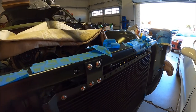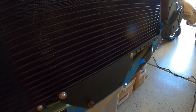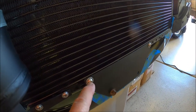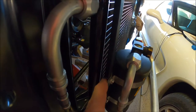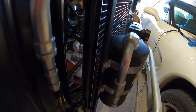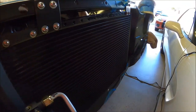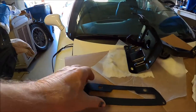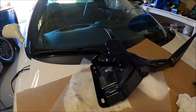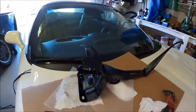So that's the modifications I made getting this thing mounted. I am going to go ahead and use their bottom mount, which works out fine. But I swapped out their number 10 stuff for the quarter 20. They also gave me some sheet metal screws, and I'm going to replace those with number 10s — I bought some number 10 button heads. So we'll get a nicer, cleaner-looking install, and I don't have to sandwich this thing in between the core support and my hood latch.